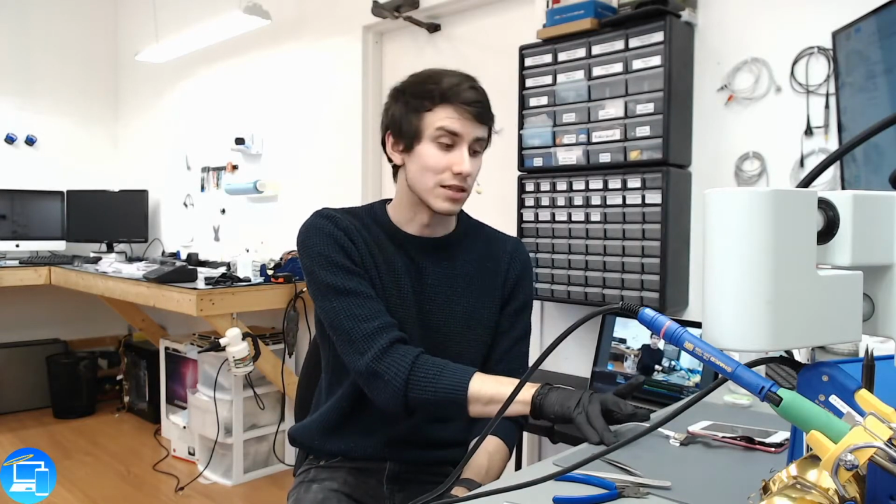Being that we hooked it up to our charger and it turned on, and now it's at roughly 70%, but before we hooked it up to our charger, it would try to turn on and then went back to battery charging. That means the design capacity of this battery has been significantly depleted. It's very possible that only 30% of this battery is usable because it is at about 70% after first turning it on. So we will have to replace the battery as well just to ensure longevity of this battery.